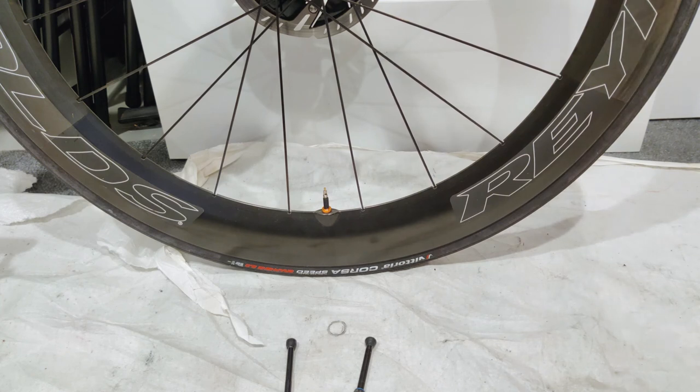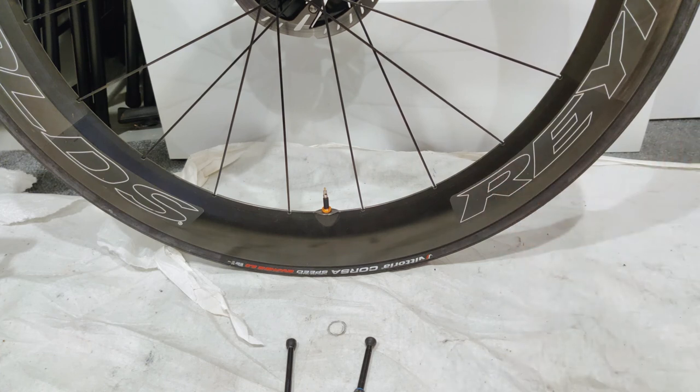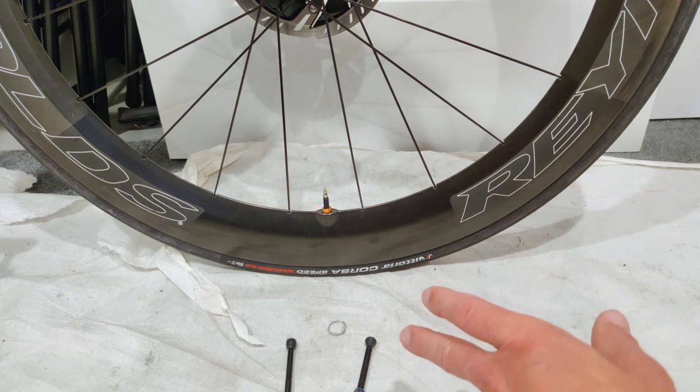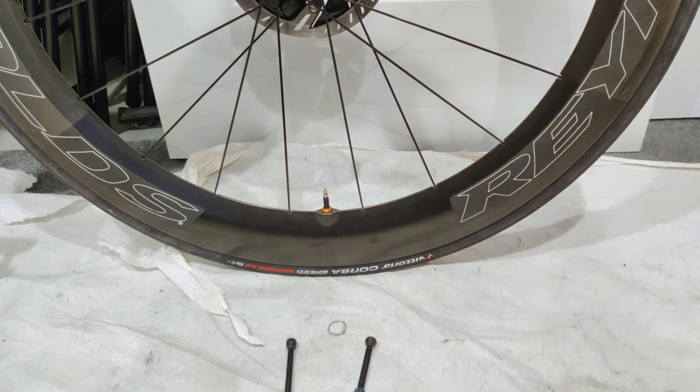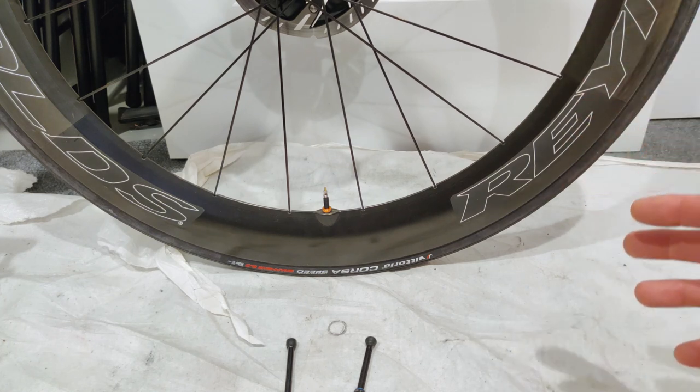And finally, the last thing I really like is the bling. I love that they include this orange nut, and if you want red you can have red, there's a black option, and all these other colors — there's even the colored core valve option, though I don't personally see the need. If you have flat rims, use the flat seal; if you have conical rims, use the conical seal. You get all that flexibility and extra stuff for essentially the same price as other competitive quality stems.